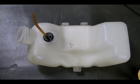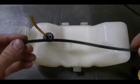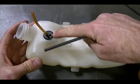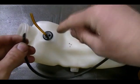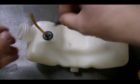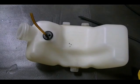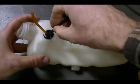If you buy the fuel line from Honda it comes pre-cut, and the length of the new fuel line is 11 and a half inches. According to the manual, the fuel line should hang out of the fuel tank 4.4 to 4.8 inches. To help insert it into the hole, I cut the fuel line to a point, and once I route it through I'll cut the end off and attach the fuel filter.